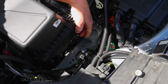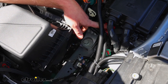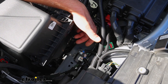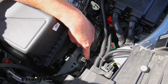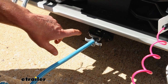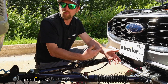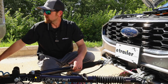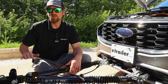The way the kit is going to work is really simple. It just hooks up to your positive battery post here — this is the power supply because the battery is actually in the back, but this goes to it. Then you've got a wire going to a circuit breaker, which will keep everything protected in the event of a short. The breaker will trip and won't harm your vehicle or your coach. Then the wire comes out of the breaker and gets run all the way down to the front of your vehicle, connected to your six-way connector. The power is received from your motorhome — from its seven-way connector, it'll send that auxiliary power through the charge line, topping off that battery and keeping everything charged up.